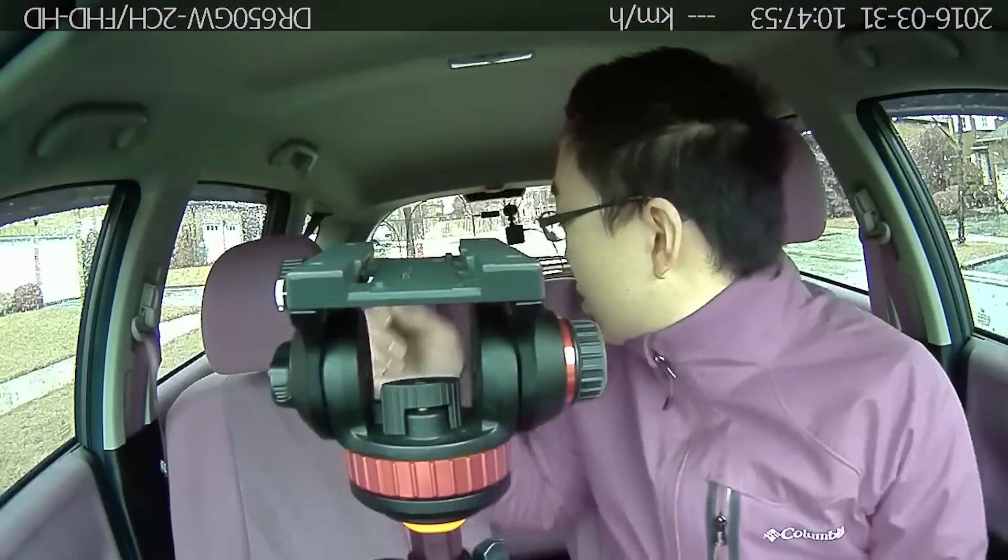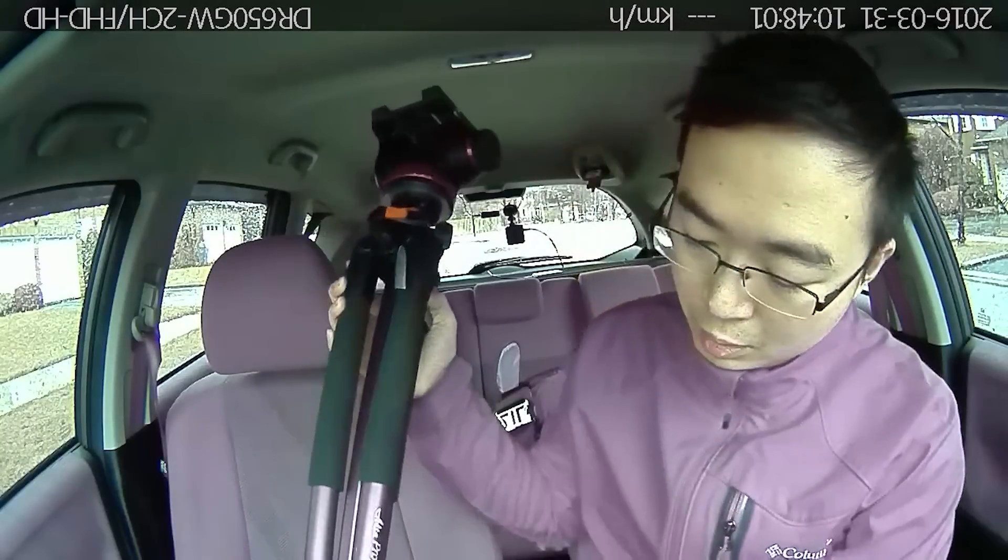The infrared camera is similar to the rear view camera except the IR filter has been removed, which allows it to pick up invisible infrared light projected by the camera. During the day, this produces a rather unflattering pink-tinted image. At night, you get an eerie glow but you can clearly see everyone inside. This would be a good feature for taxi, Uber, and Lyft drivers who may need footage of their passengers for assault, fare disputes, and other complaints — be sure to follow your local laws on privacy. However, the camera may be too expensive for most drivers as it adds another $100 to $150 onto an already expensive camera.